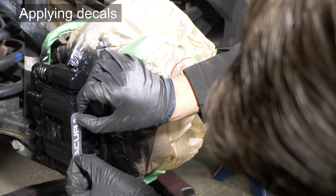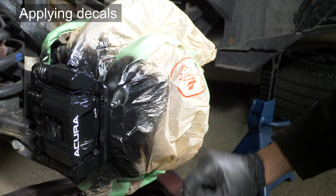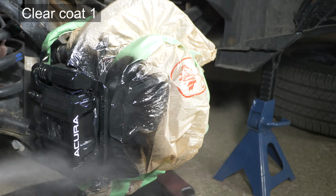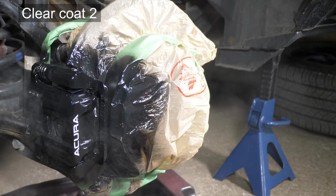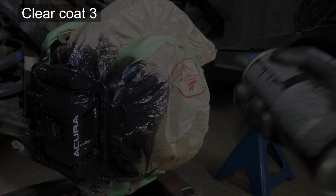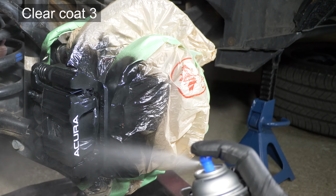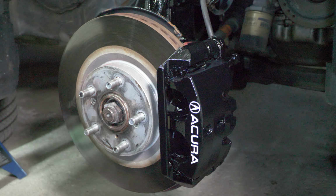The paint should fully cure within 24 hours, and it helps to bake them by either placing the car under direct sunlight in hot environments or driving it around. Braking process will also complete the baking. Try not to expose it to rain within the first 24 hours and do not wash the car. Done! Let's have a look at the final results.